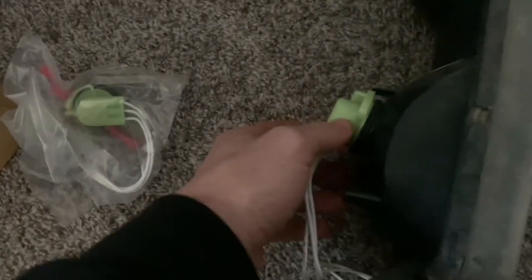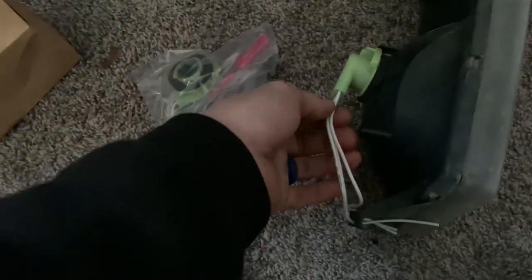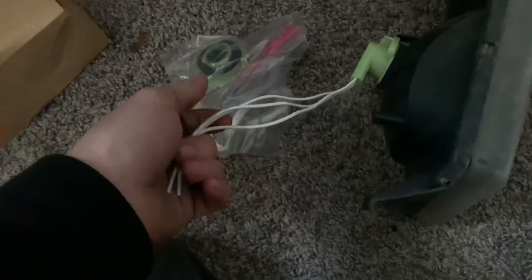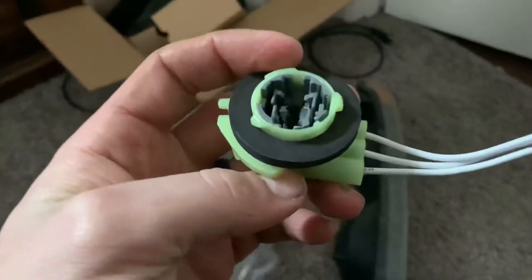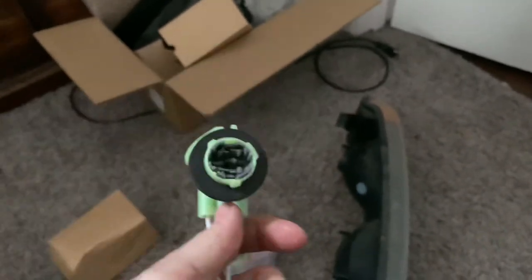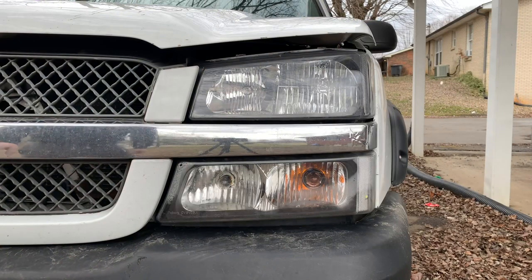It's just a lot easier than the other way, because the other way you've got to take these all apart and then you've got to hack up your harness. I'm just trying to find a way to not have to hack up the harness and make it easier. All you have to do with this is just tap into the three wires and your actual blinker light and then you're good to go — just tuck your DRL light away. If you ever want to get rid of this or put your DRL light back in, you just pop the thing back in. I'm gonna go out to the truck and see about wiring this in and show you guys how to do that.